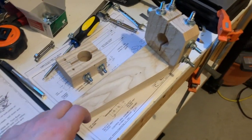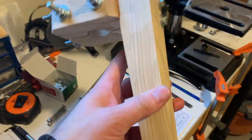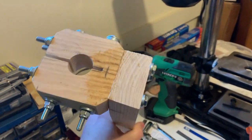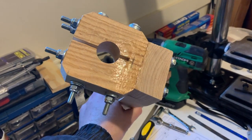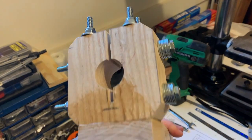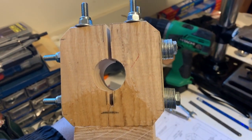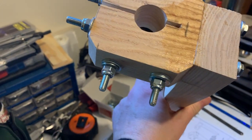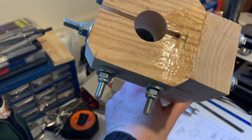So today I worked on getting the control arm assembled. I went to the hardware store. They did not have the exact length bolts that I needed. So what I did was go to the next size, and I'm going to have a stack of washers on that side, but this side, the protruding threads will just get cut off with the cutoff wheel.